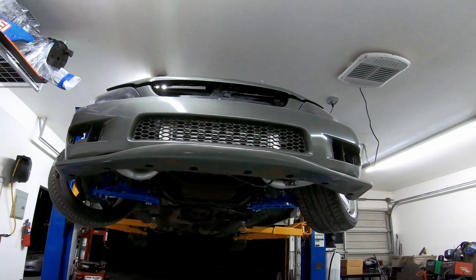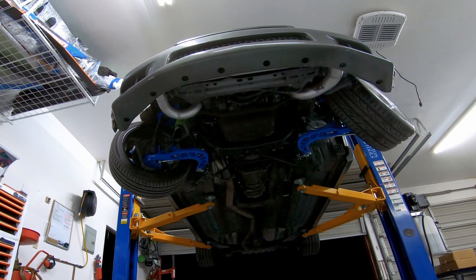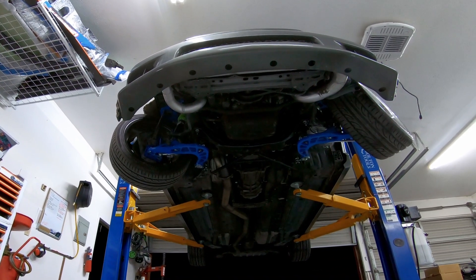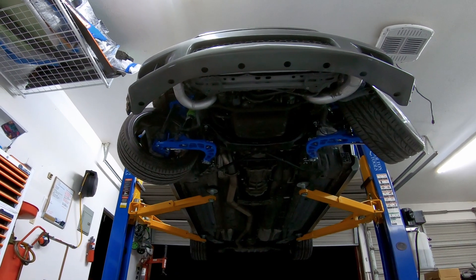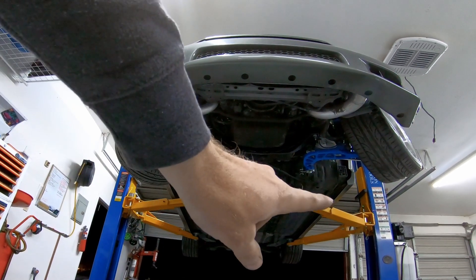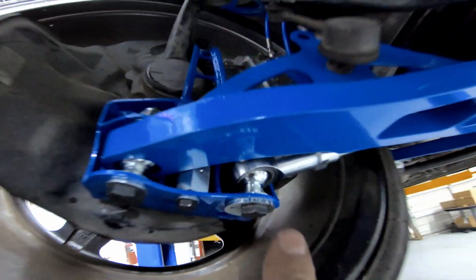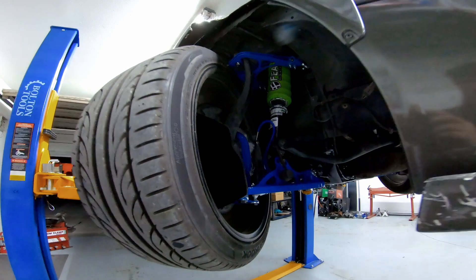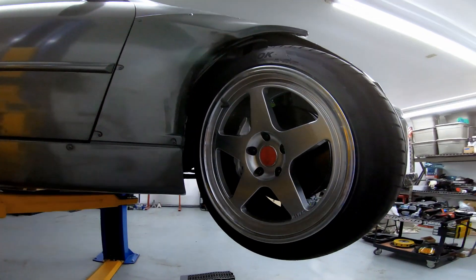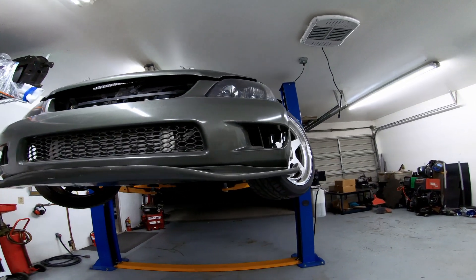Here's a shot of the angle from underneath the car at full droop — caster hasn't been set yet so things aren't exactly final, and we have the most aggressive Ackermann washers in. That's why the leading tire is turned in more than the following tire. These are the Ackermann washers — if you wanted parallel steer, you could put the zero Ackermann washer in and get fairly even lead-to-trail wheel angle.